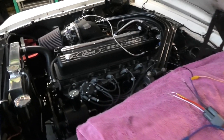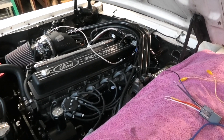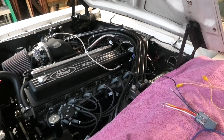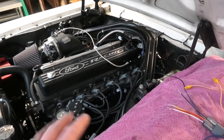You can obviously see how nicely it goes in and out of gear. It doesn't jump up in RPM and have to come back down, it doesn't drop a whole bunch. I basically picked about 20% because I know it takes about 20% more IAC to idle in gear.